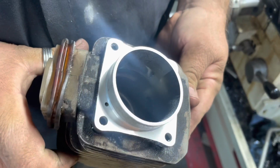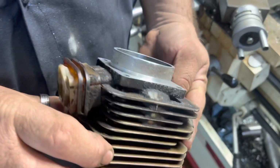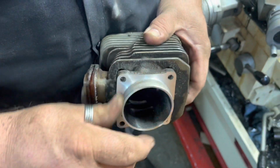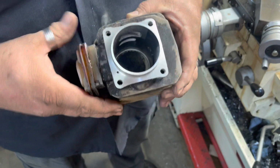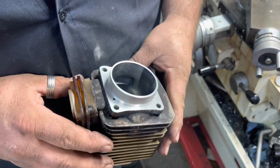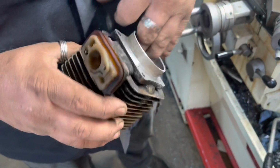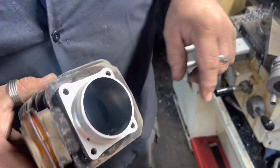There's 40 thou off the base and 40 thou off the skirt. Mm-hmm. And them carbide bits just do a beautiful job. Yeah, she's shining. The light hits it and it's just a shining. You just gotta watch that edge right there, because that thing's like a razor blade. I'll probably go through some sandpaper and smooth some of that up. So yeah, it's a little bit of taper, but I can't get in there with what I got. I need to make a tool to reach in there and do it. But if I make one out of high-speed steel...